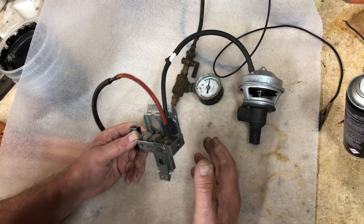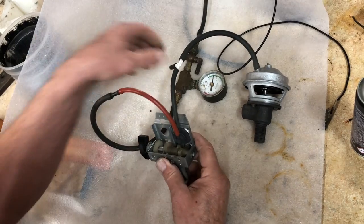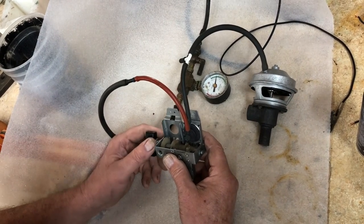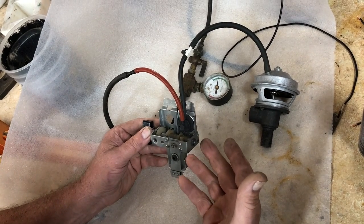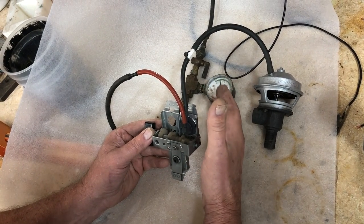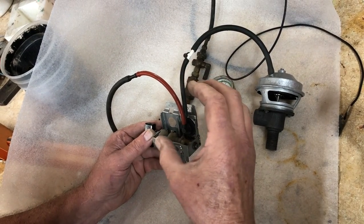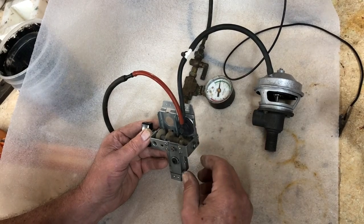The noise in the background is our vacuum pump, giving us a constant supply of vacuum — about 20 inches of mercury, which is typical of the intake manifold of your vehicle. That's providing the vacuum for this device to operate. It's likely offering vacuum through some sort of canister or reservoir, but because we have it constantly on, it's just like your engine idling.